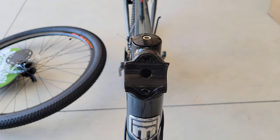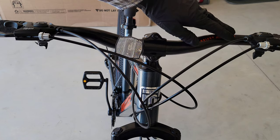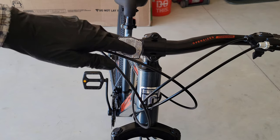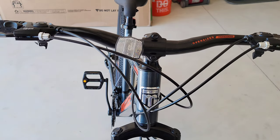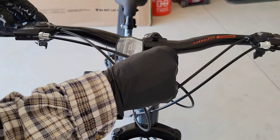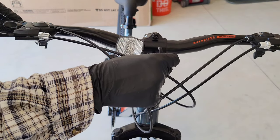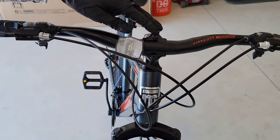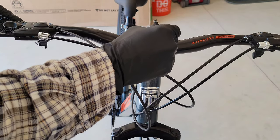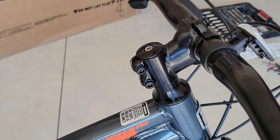I had to come back and reshoot this part. Once you get your handlebars up in here and align them properly, you want to make sure that your brake cables have a smooth arc to them — you don't want them all twisted up. Then put the front piece of the clamp back on and come in with the 5-millimeter Allen wrench to tighten these bolts back down. Make sure the washer is on there too, and tighten them down little by little, going back and forth. Don't tighten one all the way before doing the other — you want the clamp to go on evenly.